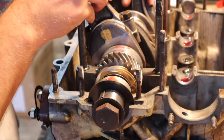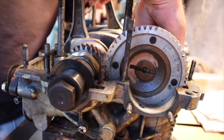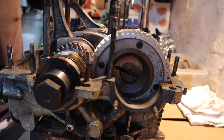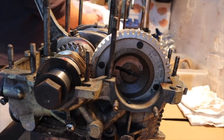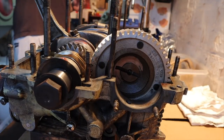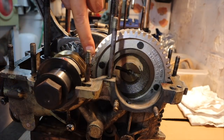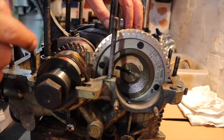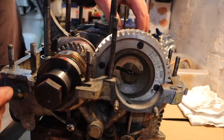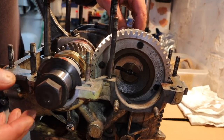Some. So this bad boy goes somewhere there. Oh, look at that, man, I've nailed it. Has that just happened to fall into place? Well, it's probably unlikely that it's exactly right, but it's around the right place. Can you shine the torch then so I can see? Do you see the dot there? I see the dot. Well, there should be two other dots on the other pulley. Can you shine it on the other pulley from around there? Do you see the two dots on the other pulley? Oh, yeah, so is it one notch out? I think we're one notch out.